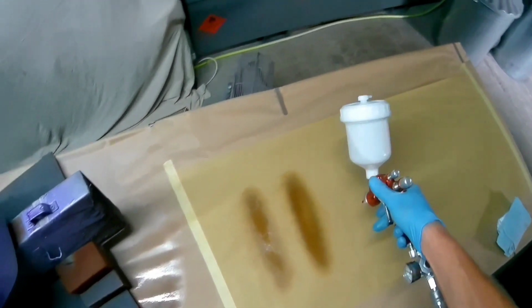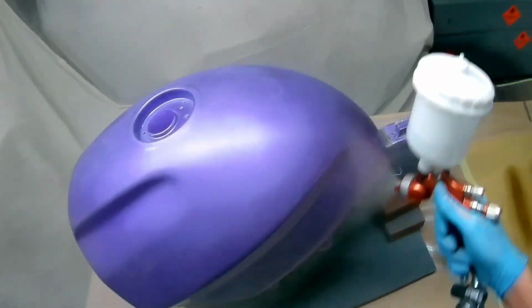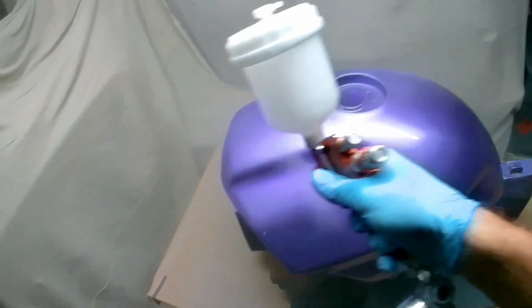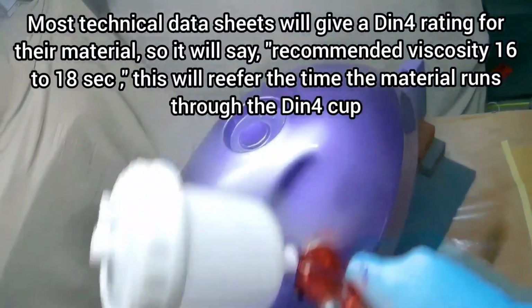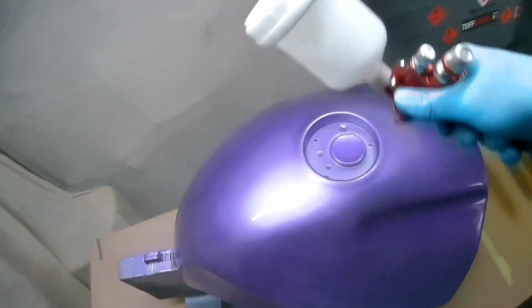And it's another reason for heating the clear coat as well, because I'll try and remember to put a link in the description to a video I did where I was literally measuring the viscosity of the clear coat, and one is at about 8 degrees Celsius. What's that in Fahrenheit? About 44, 45. It's a standard DIN 4 cup, or a Ford 4 as they call it, basically a cup with a 4mm hole in it. You measure the amount of time the liquid takes to go through, and that effectively gives you a chance to gauge the viscosity of it.